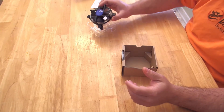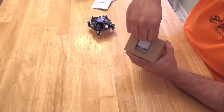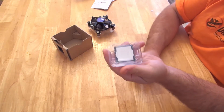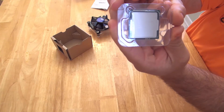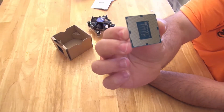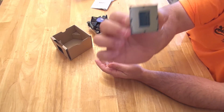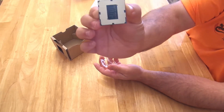And last but definitely not least, the processor. You can open it up by pulling it this way, undoing it, or just easily slide it out. Here is the CPU — you can see it up real close. All the little print on the CPU. Take this out. Here are the pins on the bottom. You don't want to touch these guys. The grease on your fingers is not good for this. You can be the cleanest person in the world, but you will have grease on your fingertips. Try to avoid touching it. You're going to get a little on there when you install, unless you wear gloves or something, but just try not to touch it.